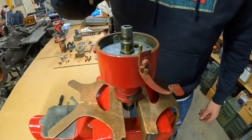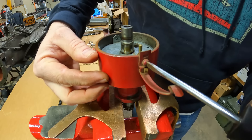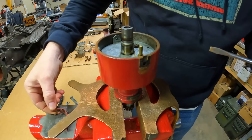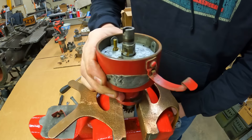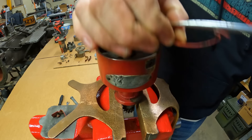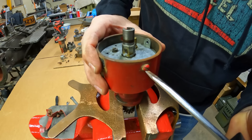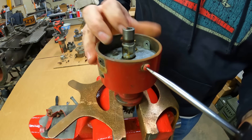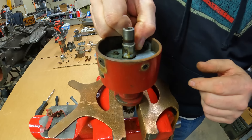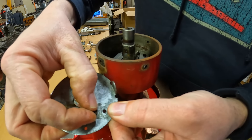Next we need to take this flat plate out - that's what separates the upper portion of the distributor from the lower portion. Three screws hold it in, and two of the screws also hold these cap clips to the outside. So we'll begin by taking those off - keep rotating it around so you can see what I'm doing. The third screw just comes in from the back side. And with those out, the plate just comes right out the top. This eccentric screw is mashed over on the back side so it does not come out - it just rotates in there.